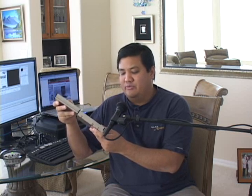This diminutive-looking device actually doesn't look like a whole lot. There are a lot of drive trays out there that look kind of like this. You've got the whole steel-aluminum construction with some plastic parts, a PCB, and some sort of connectors on the back. But even though it doesn't look grand, this is actually a pretty decent device. I have to admit I had not heard of CRU until they asked us to review this, but this is a nice portable storage solution. It's got USB connectors for full USB 2.0 at 480 megabits per second, and a SATA connector so you can get the 3 gigabits per second transfer if you have drives that can support that. It is a very nicely constructed little unit.